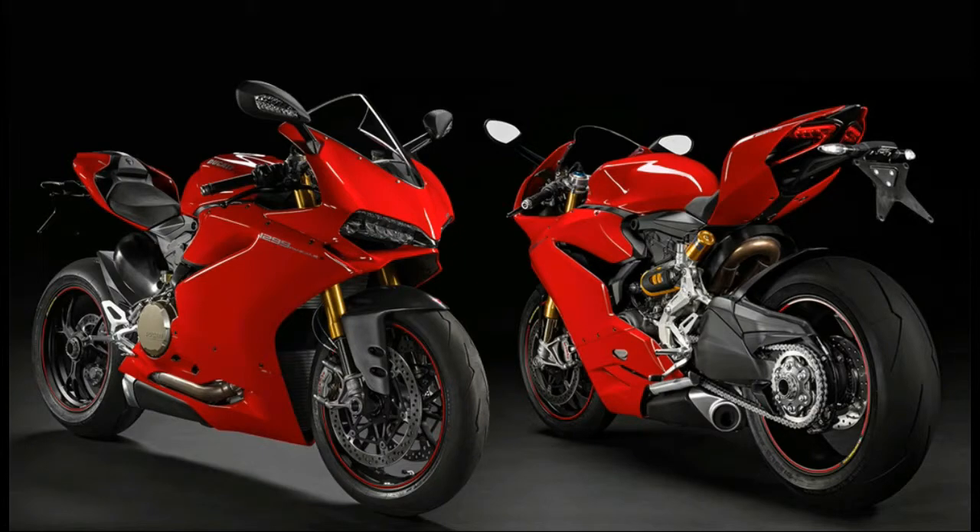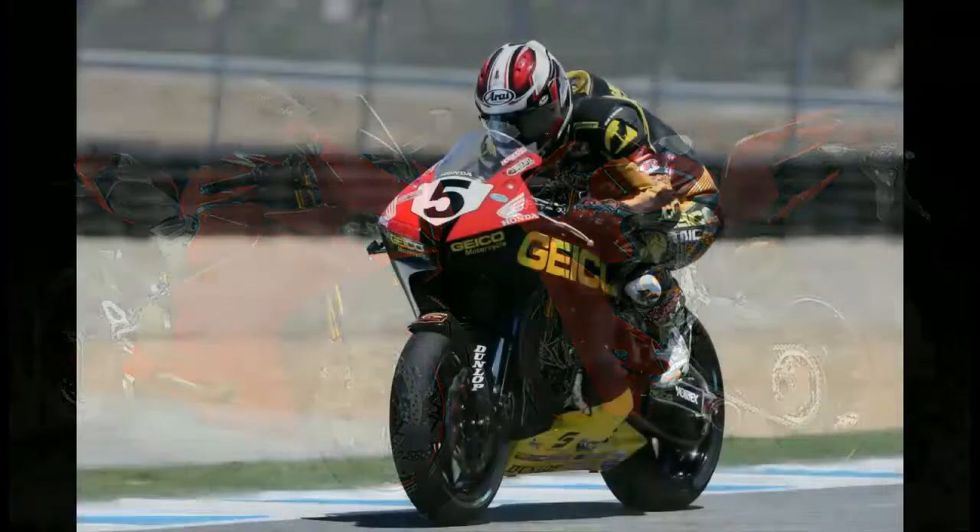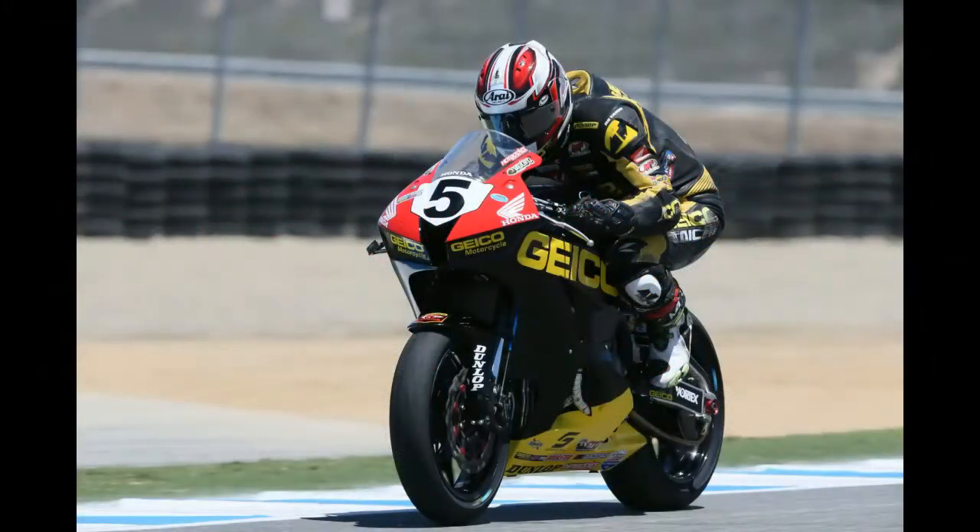When the bike is vertical, the suspension is moving, Auxia says. When the rider leans it over at 65 degrees and hits a bump, all those forces are now lateral, so the suspension doesn't move as much, and you're relying on the flex in the side wall of the tyre and the flex of the frame and swing arm and everything else. All these factors have to be considered when programming a map for a superbike race.